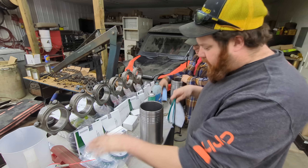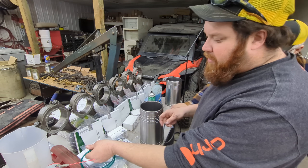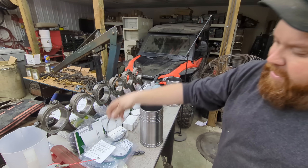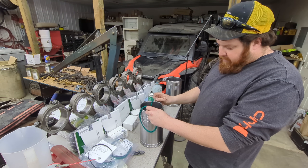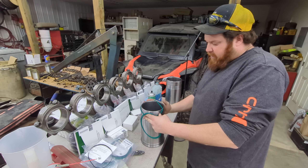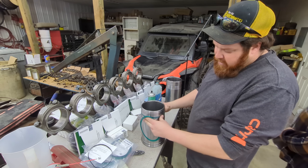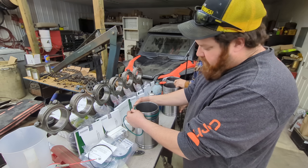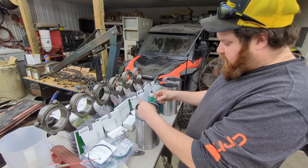The three green O-rings go in the grooves on the liners, and then the black O-ring goes around the top. It's not actually an O-ring, it's just a sealing ring. The black one gets engine oil on it, and the engine oil makes it swell, and that's what seals it up in its groove.